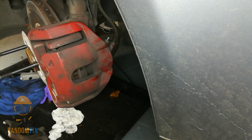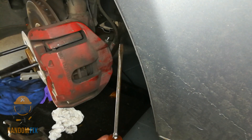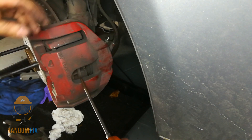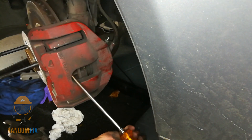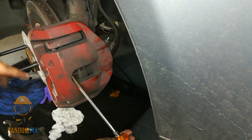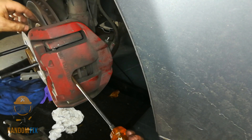To do this, all you're going to need is a screwdriver in different sizes. Have the top of the brake fluid reservoir off before you do this. You want to gently come in here, and only do this when you're replacing the rotor, because we're going to be pushing against the rotor so it might end up scratching it.